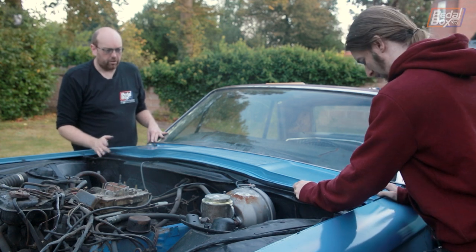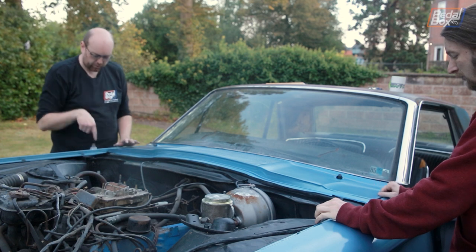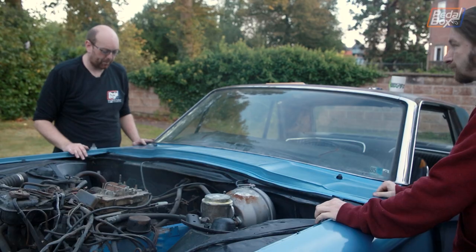It just pinches down, goes straight through and fits in. And these are like 3/8 body screws, really coarse threads. They just drop straight down. And this also goes into the wing at this edge. And then once that's in, we can tighten all of the wing bolts up.